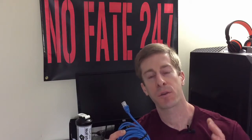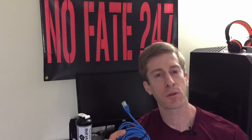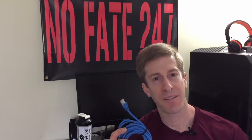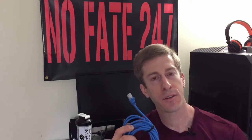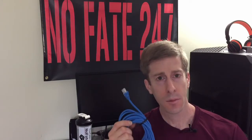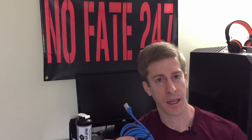This doesn't just count for laptops and desktops. Your Xboxes, PlayStations, and Blu-ray players all have an Ethernet connection in the back. If you're close enough, I highly suggest running an Ethernet cord — you're going to see a drastic improvement in performance. Also, connecting these devices with an Ethernet cord will cut down on wireless interference because those devices will not be seeking out and using the Wi-Fi bands.